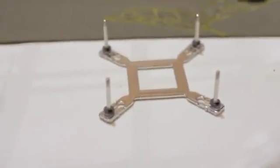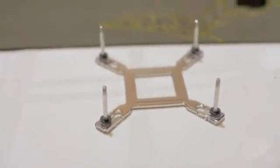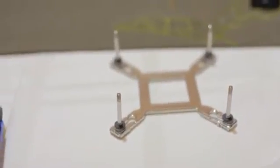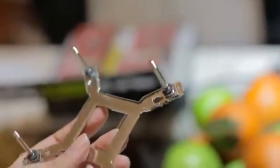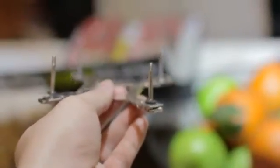The next step should be pretty straightforward. Once you put the rubber mounts in place, you're going to get ready to take your motherboard off and place them in the four holes surrounding your CPU. I have an ASUS motherboard, and for the i5 chipset at least, you'd have to bring these in by one notch so they'll fit correctly into the back of the CPU. By default they come fully extended, and that won't quite fit.